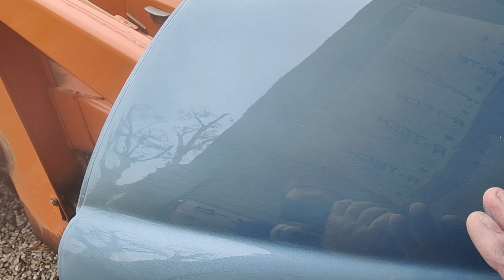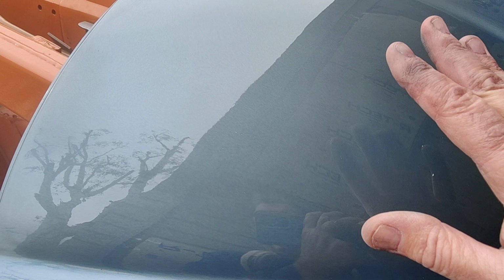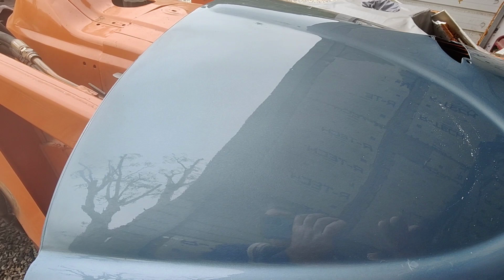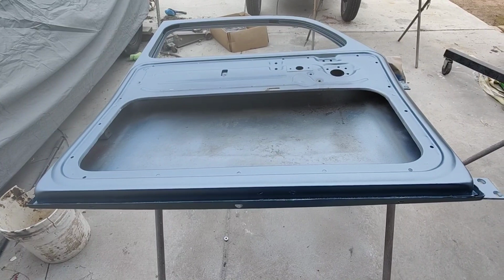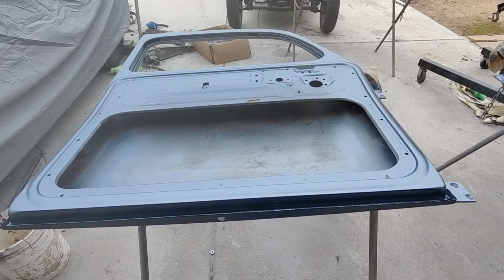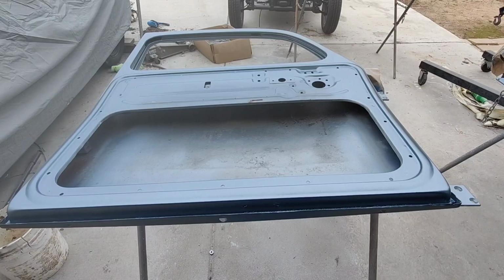On this, I had some problems. I forgot to put the accelerator in the clear, and I only had slow, and it was really, really cold out. So this Tamco really likes to just keep going. Yeah. It's a little bit unpredictable. If you ever want a really predictable clear, the Transtar E3. It's not high solids, but man, it's predictable. And the only thing I found with that, you have to go really slow on the hardener. Go to the slowest one, or the medium one will dry like fast.